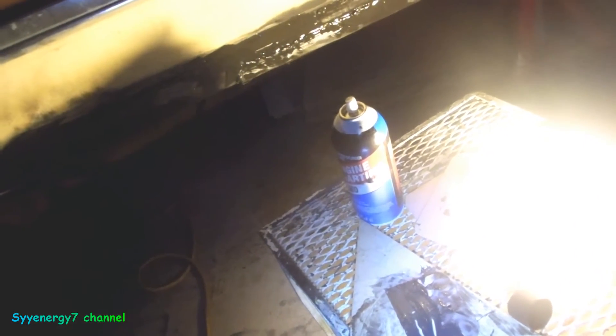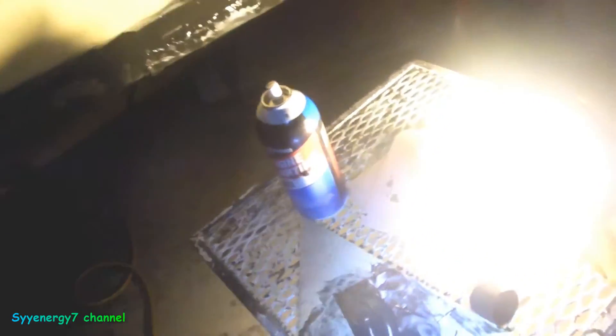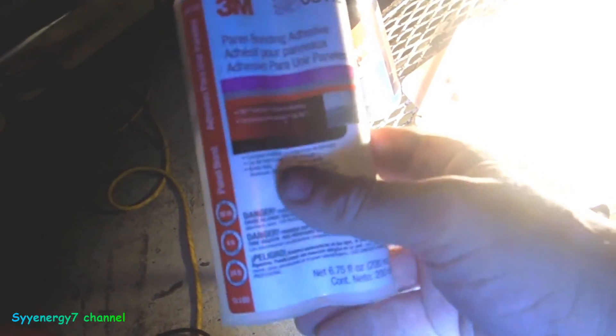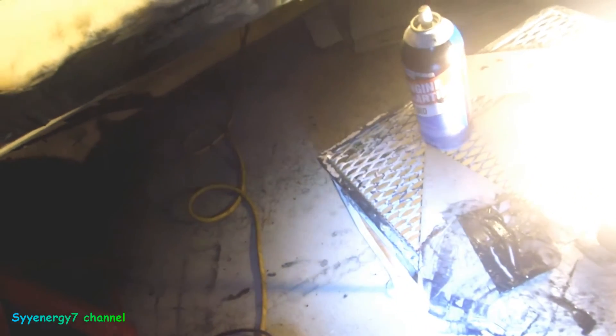So if you got some crappy welds — grind them down, maybe there's some porosity and you're afraid a little moisture is going to come through. Put a skim coat of this stuff on it. It's not that much money if you don't have the gun. The gun is like a hundred bucks — I said why would I spend money on that since I'm not putting on quarter panels. I just put these two things together and press it against my chest, either on a metal plate or squeegee, mix it up like plastic. As far as I'm concerned, it's going to come out okay. It'll look better than it was, and there'll be no rust.